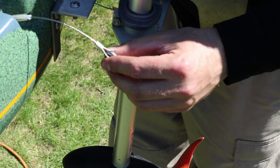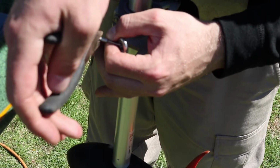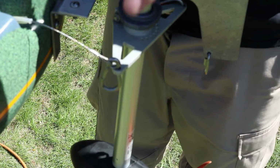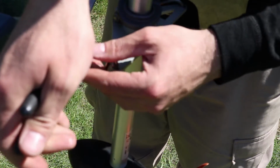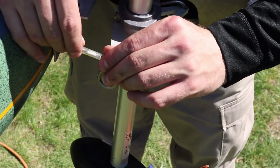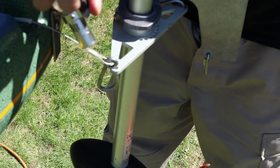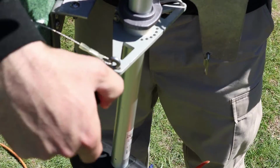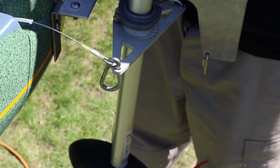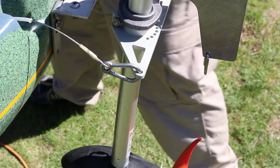Okay, now we're going to want to, using our pliers, crimp that down. Maybe you can trim off the tag end here. Slide the heat shrink tubing over, and using a heat gun or a lighter, just simply shrink that onto there. Wet your fingers to close it. Else you'll burn yourself. Either wet a little spit off your tongue works. That's it there. Steering.